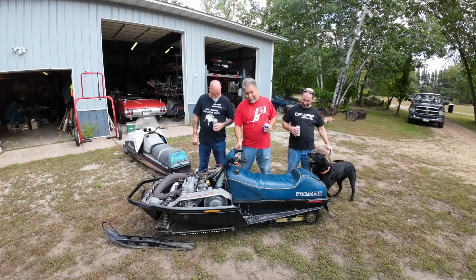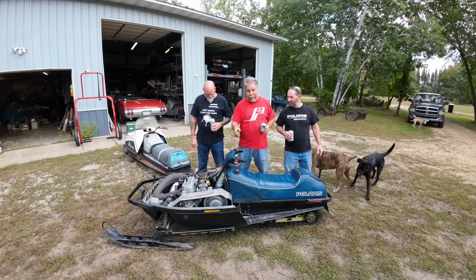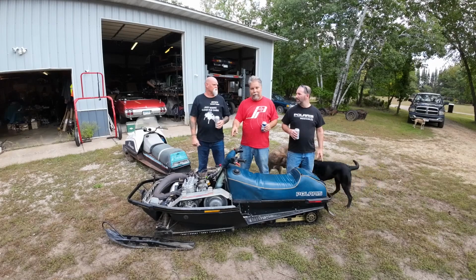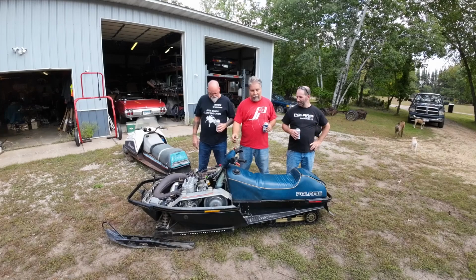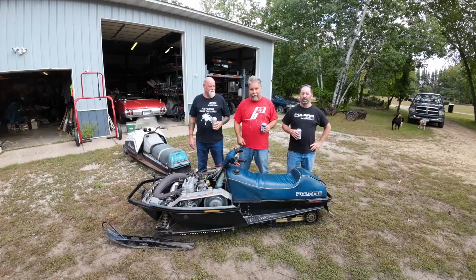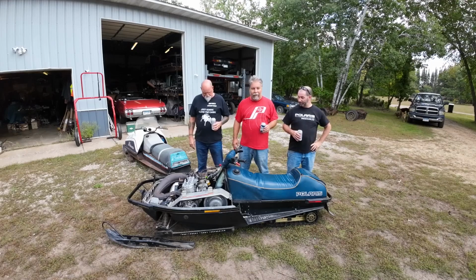What else? Oh, yeah, I got to tighten up my handlebars. You guys saw those move. The not coming out of reverse, that's due to the belt being too tight. There's just too much tension. So you saw earlier when we killed it and I jiggled the secondary, it popped right into forward, and did it again now. So that's all related to that. That's the main issues.